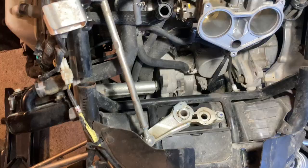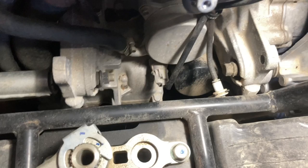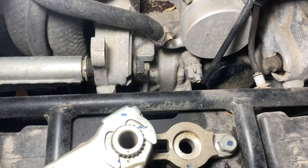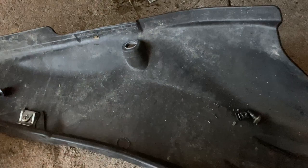With the air box off I'm going to try to remove that other side panel too, because the oil from the filter is probably going to spill there and I'll get better reach. We also found a winter stock of canola from the local mice! The left-hand side panel is the same — two bolts and one allen screw at the foot kick. Pop one more little piece out of the way, remove this hose, and we should have access to get the filter wrench onto that filter.